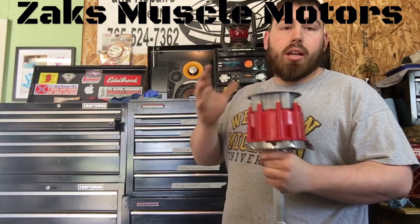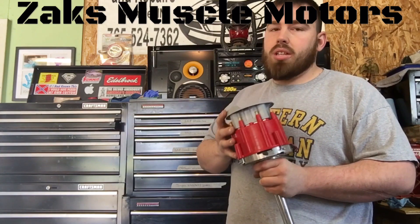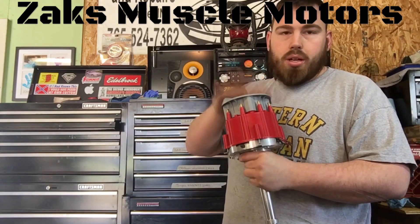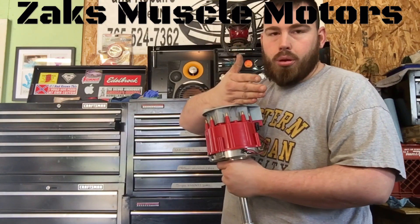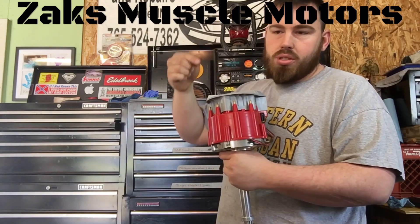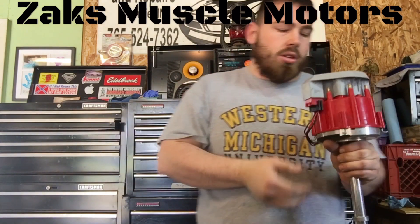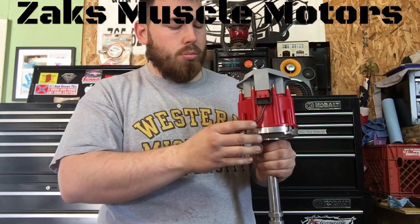It's not just as simple as saying it's a set number. If your engine is a little more worn out, you might have to compensate for that because it's not going to run like it was brand new — you might have to make an adjustment. But the basics are here: 1-8-4-3-6-5-7-2, line up your rotor button with the number one cylinder at top dead center, put your plug wires on 1-8-4-3-6-5-7-2 on any of these pedestals, as long as it lines up to your rotor button with that post. Don't worry too much about these wires as long as you've got them plugged up — that's just for your HEI ignition control module.